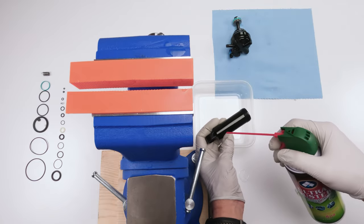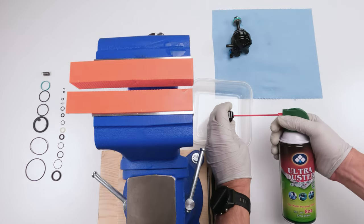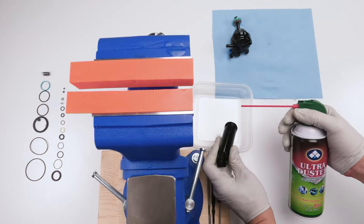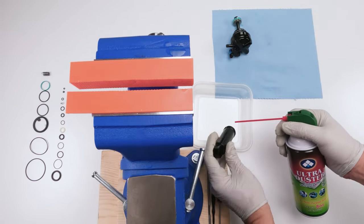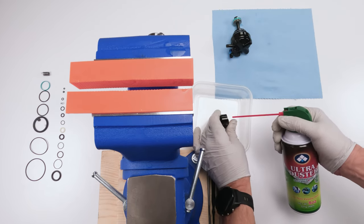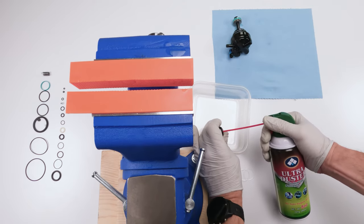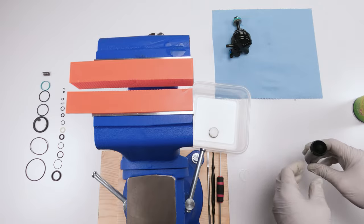So ultimately there's a hole over here where we fill up the IFP chamber, right? And we are gonna press air. We're gonna put our damper side down, but don't put it flat on the ground. Leave about a millimeter, 2 millimeters of space, so the IFP can come out, okay? And just apply air and done. And there's our IFP.